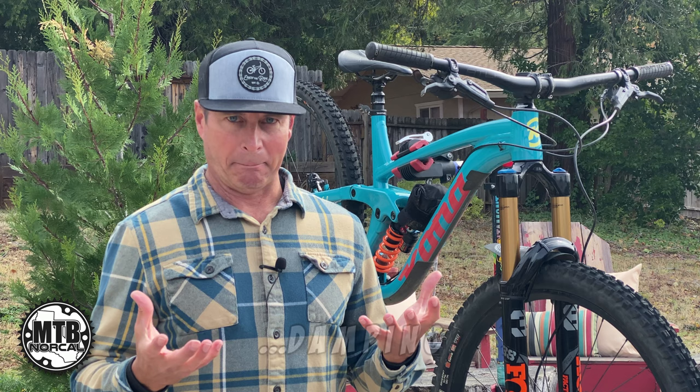But most importantly, I've heard of damping characteristics of tire compounds. I've never experienced it. I've never really looked into it, but now I can talk about it. So the DH casing, or softer compound, related to 10 to 15% more compression damping or suppleness. It felt like I had a longer travel bike. So the downhill casing or softer compounds related to the damping characteristics of the tire, adding to the suppleness or compression damping of the bike, if that makes sense. It felt better, and it felt like I had not only the expected more grip, but a more supple suspension.